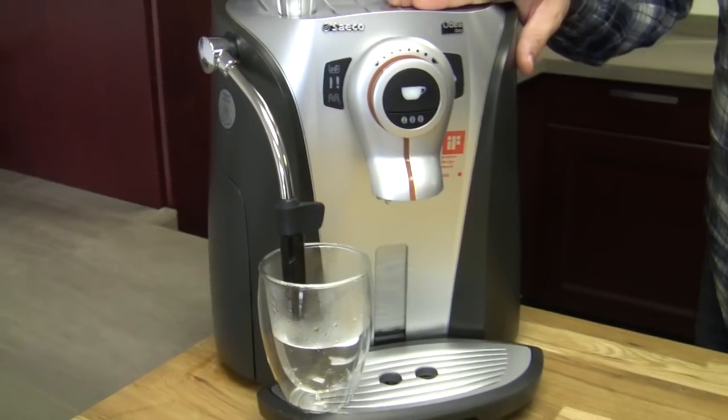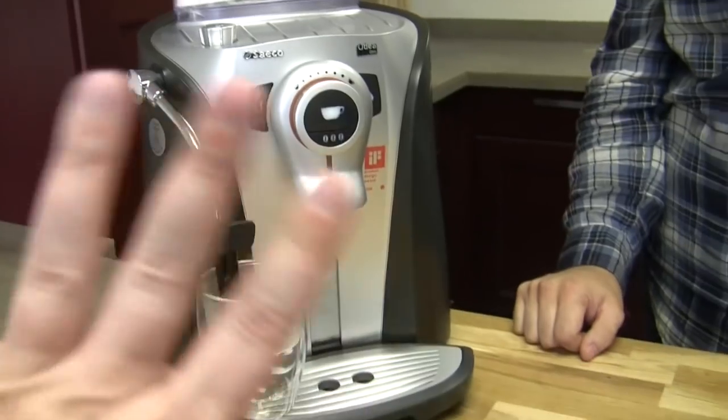That's test mode on the Odea Giro series. You can control those six things and you can get kind of creative with it. Let's say you have a machine that doesn't rinse the brew unit when it heats up — the Vienna is a good example of that. One thing I've told a lot of people to trick the Vienna is: let your machine heat up, then put it into test mode and rinse the brew unit yourself. You can put it into work position and do it that way. So basically this is just a great diagnostic tool — what's actually maybe wrong with my machine, do I need to take it in somewhere to get it looked at? You can figure out what the actual problem is and see if it's something you yourself can fix or if it needs to go to a service center. Test mode on the Odea Giro series of machines by Saeco — and Brendan. Thanks B.